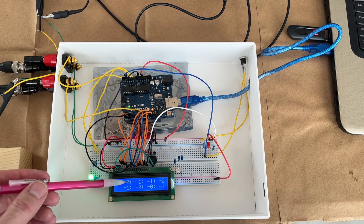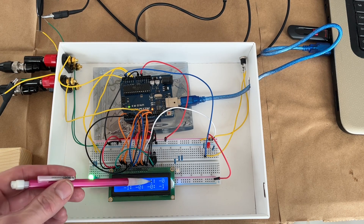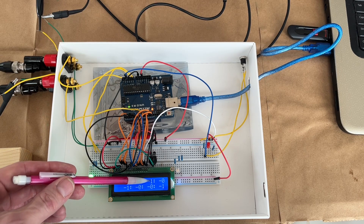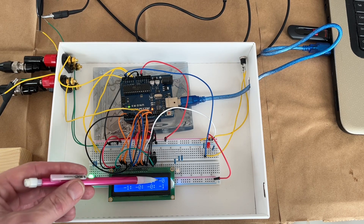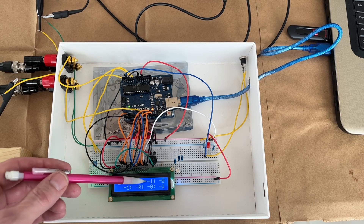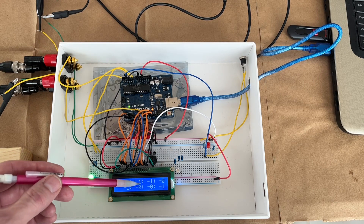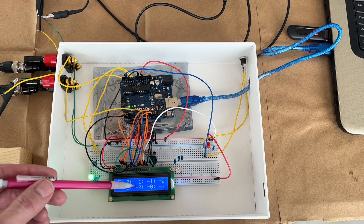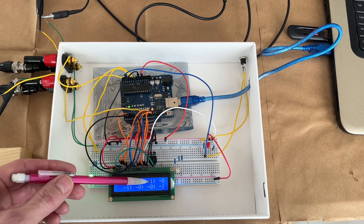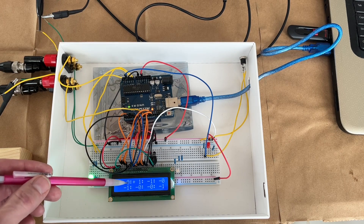This adjustment is about as good as we can get it. Here's our reference first cylinder, then we've got plus one degree on the next cylinder — that's the movable. Then this is the fixed, so there's nothing we can do about that minus one error. The remaining cylinders on the movable plate show small numbers, and those on the fixed points show similar values. We've got a plus one and a minus one, and then some numbers pretty close to zero.